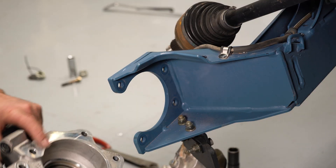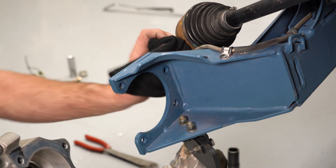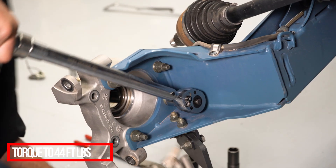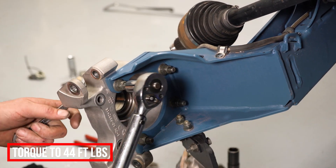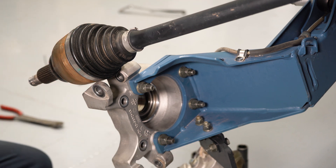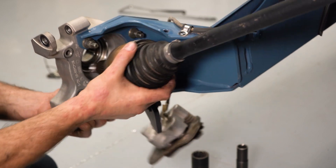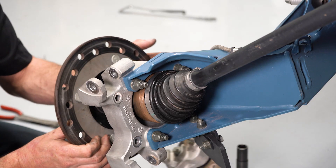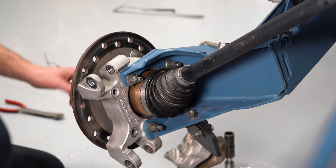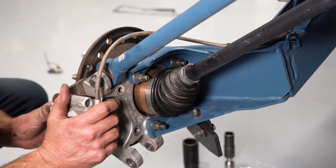Just before putting the carrier back onto the trailing arm, clean both meeting surfaces of the bearing carrier and the control arm. Install all four bolts loosely before tightening any of them. Now we're ready to stab the axle back in through the bearing carrier — just note that when you spline the hub on, orient the cross through holes for your cotter pin and retainer to be opposed to your lugs so that you can get tools in and out. Now that the hub is on, put our upper radius rod in position.